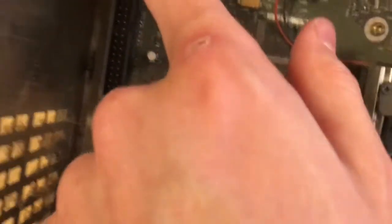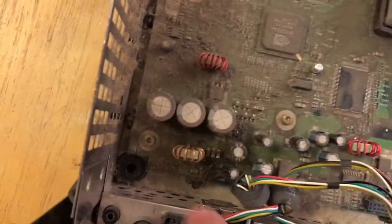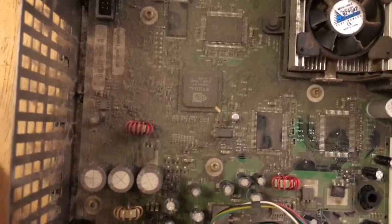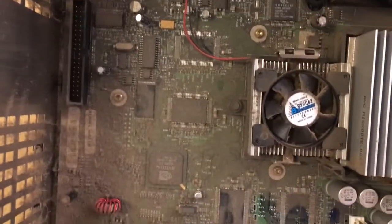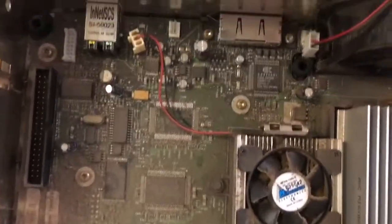But anyways, there's a bunch of these Torx screws here. One there, two there, one more over there, there, and this is a 1.0 Xbox, so everything's going to be different on here, you know, where the connectors are at, where the clock capacitor is, where the screws are. So if you have a different model, then it's not going to work for you. But anyway, we've got one more there, and there might even be some that I missed. But just look around and try to remove any of them you see. Try to remove the board. If it still gives you trouble, look harder, because they're everywhere.